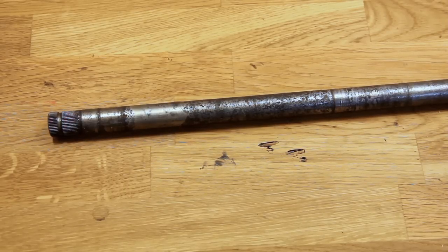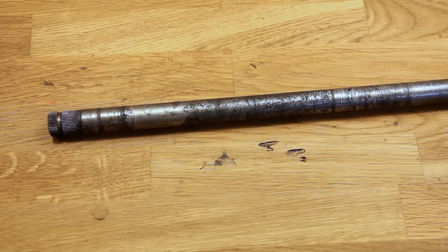You may ask: if this happens to me, what should I do? The best thing is to get a new half shaft, but they can be expensive. Some people do weld them back on instead of using C-clips to hold them on — it would probably work very well, but the weld could break within a year or so, meaning you'd have to go back inside the gearbox, pull out the differential, and either redo the work or put a new one in. My recommendation is to just buy a new one — although it is expensive, you're pretty much guaranteeing it's going to work for a lot longer than a weld.